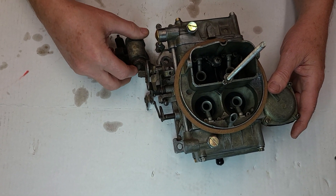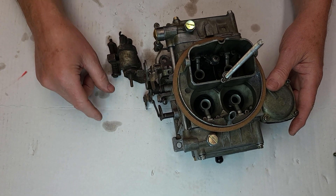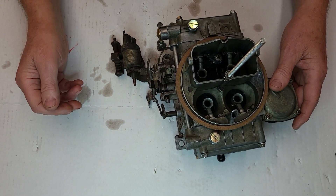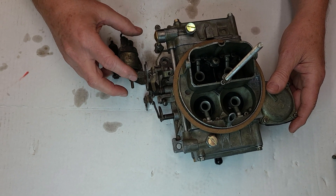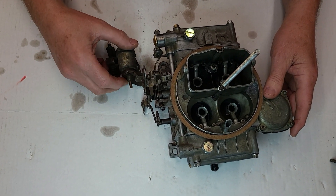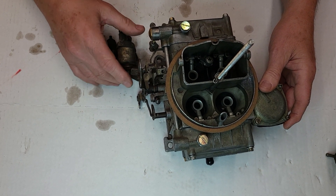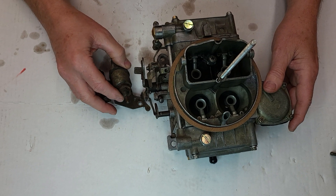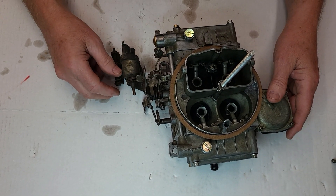That's all I've got for right now. I've got some more of these — I'm going to try to find a vacuum-operated one and show you. It has a solenoid that'll sit over on the side of the motor, and it will actually have manifold vacuum going to the solenoid. It's just an open-and-closed solenoid — it lets the vacuum go through to the vacuum-operated dashpot and then close. You can actuate it with the AC or anything you want. They're just idle compensators. This one is called an anti-diesel solenoid — when that idle drops down real low, the motor will cut off and will not diesel, unless it's burning up. It's something nice to have, especially if you're driving your old hot rod in traffic and you want to cut it off without it dieseling, or you've got AC and you want to compensate for the idle drop. Works like a charm.